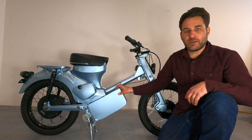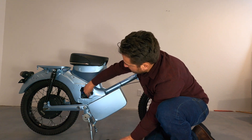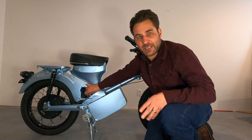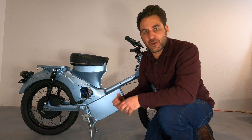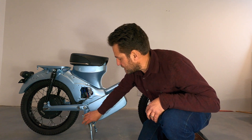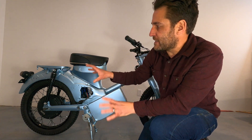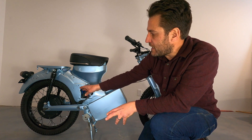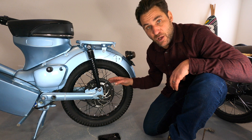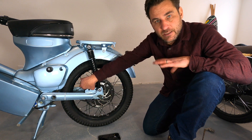The CT90 has a large battery box for the 35 amp hour battery. Underneath the cover is a bunch of electronics — basically the plug to charge it and the plug from the battery to the controller. It doesn't have a nice switch like the other bike, so you have to plug this together to activate the whole system. It's got a new seat, the original gas tank, original kickstand parts, original swing arm, and aftermarket shocks. It has a new-style rear light with turn indicators incorporated, the NBP rear hub motor on a 1.6 by 17 wheel. The rear brake uses the mountain bike-style setup — a flimsy 6-bolt rotor with a welded-on tab to mount the caliper. It's not as powerful at all.